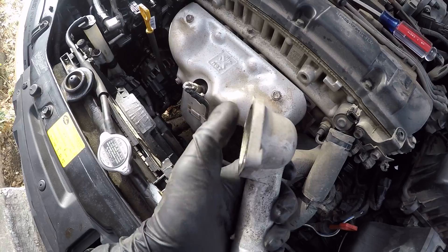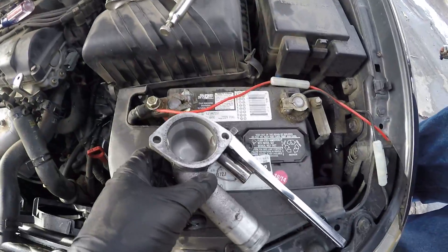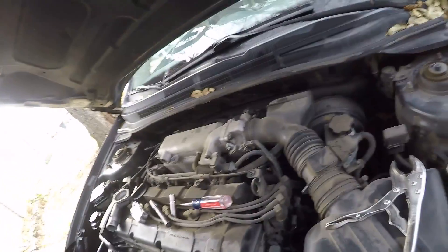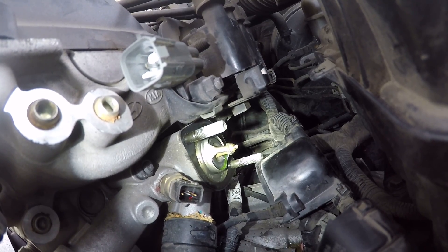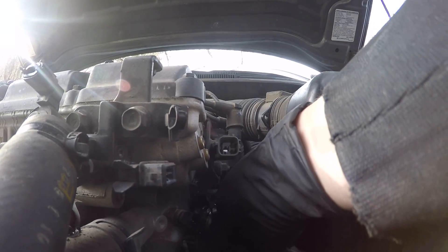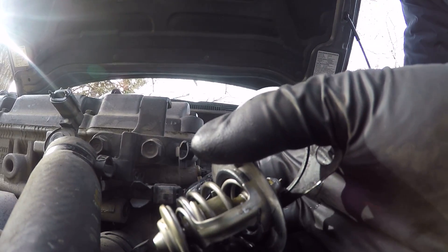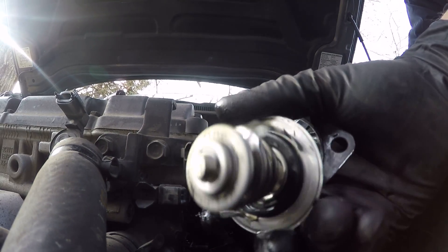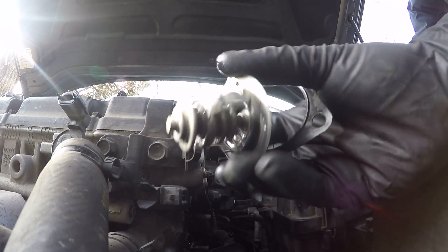This guy should just pull free now. I'll give you guys a close-up. This is what was connected to the engine — the thermostat is sitting inside of this, but it's also inside the engine. So this is what we pulled off. Right there you can see the thermostat in the middle. I'm going to pull that off and then work this washer off with a razor blade. Quite a bit more fluid is leaking out, but that's all right. Surprisingly the gasket here came off in one piece, so we won't have to scrape too much — I'll double check it with a razor blade to make sure it's nice and clean. Here's the thermostat as removed — it all worked out pretty good.